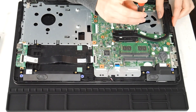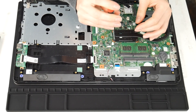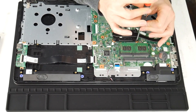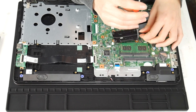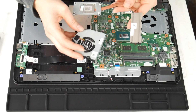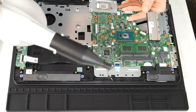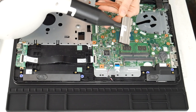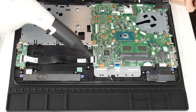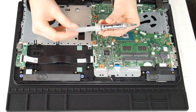Next I'm going to clean the heat sink. This is another big reason why a computer overheats — the fan and the heat sink not working properly together. Now that I've gotten the heat sink off, I'm going to clean out that little vent because the fan takes air and expels it through there, and all that hot air goes out. If those two things aren't functioning properly, your CPU and motherboard can't stay cool. I give it a good blast with the air cannon — these are great because you can clean out the inside really easily. Sometimes you open a computer up and it's filthy.